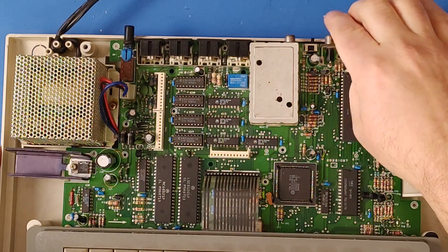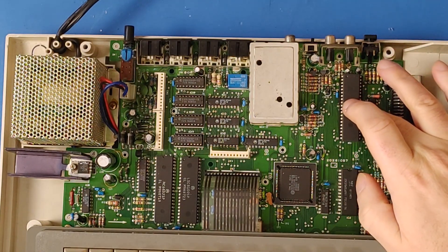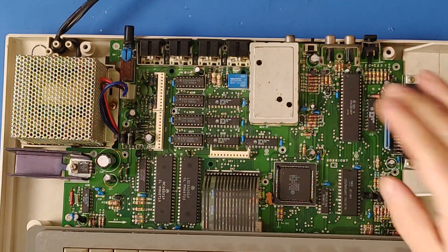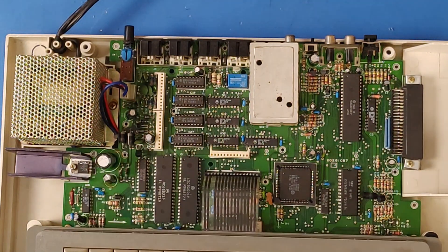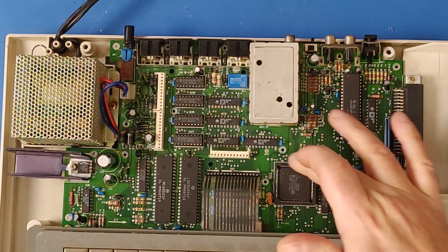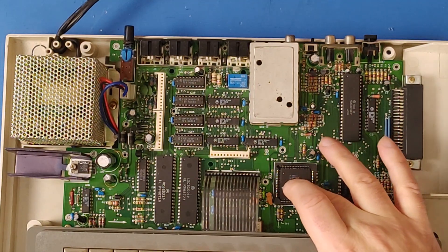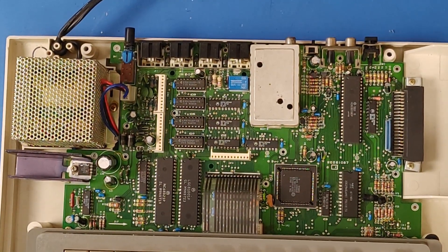Added to this one is the composite out for video and audio. Many of the chips in here are also the same — you've got your 6309 or 6809 depending on the computer; this particular one is a 6309. You've got your ROM, your two PIAs, and there's also a SALT chip which is kind of a Color Computer exclusive. Something different is this big square chip here, which is the Advanced Color Video Chip. This allows the Color Computer 3 to do a lot more than the Color Computer 1 and 2 ever could with graphics.